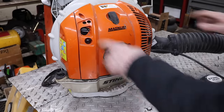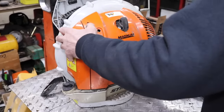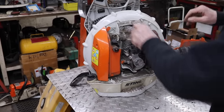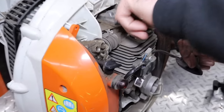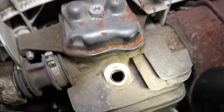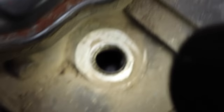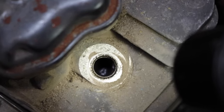Got to pull the recoil. There's two screws here, two screws there. That removed this cover, which I had already taken off. We're going to take the spark plug out. And I'm going to show you what's going on here. Mr. Cameraman, you're going to have to get in that spark plug hole, because that rattling noise is the piston. Can you see that? Can you see the piston flopping around in there?